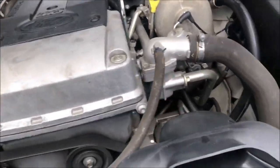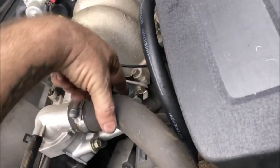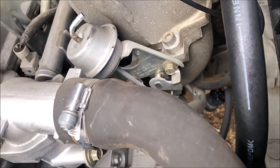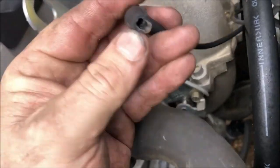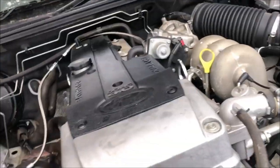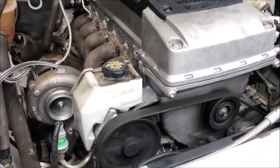I'm just letting it run, looking for leaks. It's obviously not running any boost at all. On the NA manifold, there's a butterfly in here which needs to be disconnected when you're running boost. You just pull this off, that opens the butterfly. Once I start running boost I'll have this disconnected — I'll block that off so we're not getting any vacuum. I'm pretty happy, there's no leaks so far. Next step is to put the exhaust on.